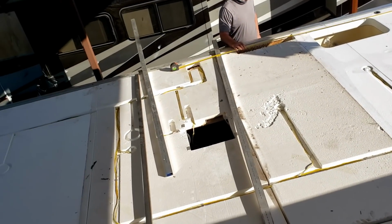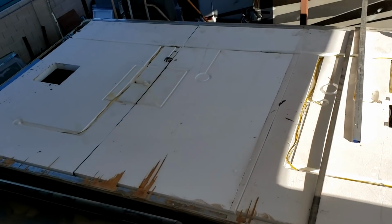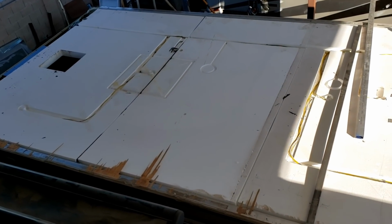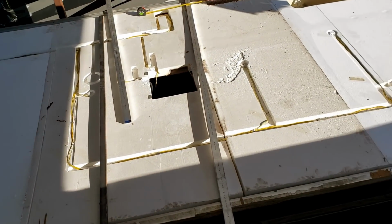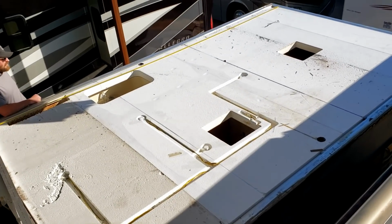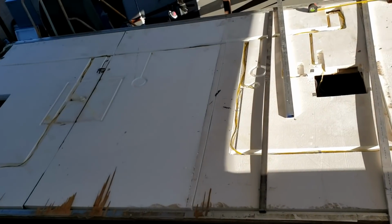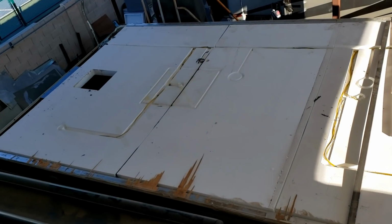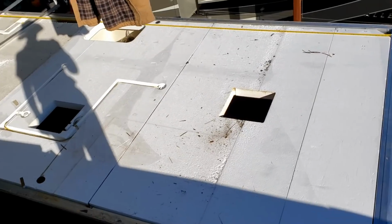I think we're going to be moving to steel instead of aluminum. We can go 1 inch thick, and we should be just fine at that when we get wood in the middle of the tube. We'll likely have 3 joists to a 4x8 sheet, so we're just measuring it out to know how much we want to put on there. It's a good view of what a Winnebago roof looks like though.